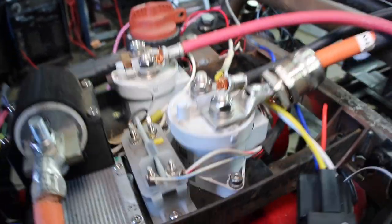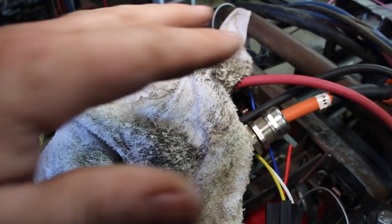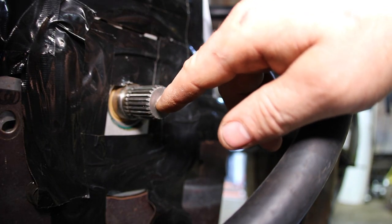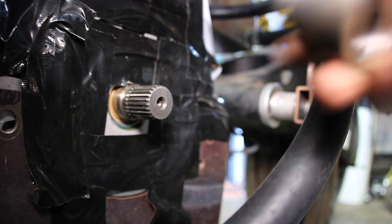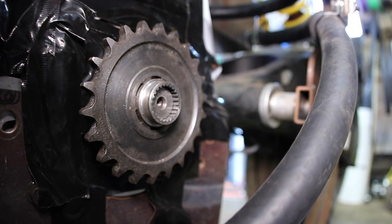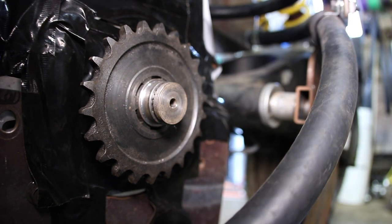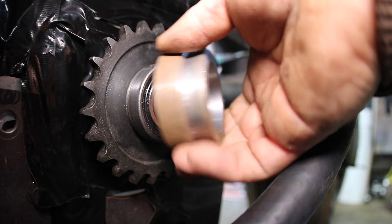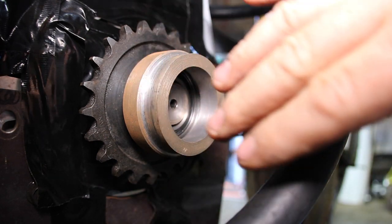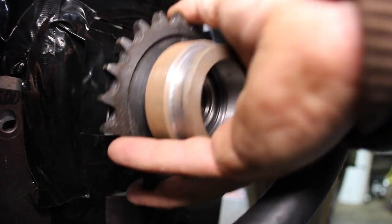I'm not going to touch them because it's about 380 volts. I'm going to cover this bad boy up so we don't have any mishaps with tools or anything. I'll be making a nice little cover that goes over the top later on, but for right now for testing it's easy to have it accessible. Right here we have the motor output shaft. There's a piece that goes on — this will be the sprocket that's welded to it. After that there's a cap, a bolt goes right through, and then an outboard bearing support that goes over the top. Additionally a plate bolts it to the actual body of the motor, so any torque applied will be transferred into this plate and keep the bearings from wearing out inside the motor under large torque.